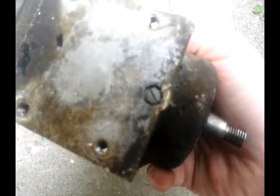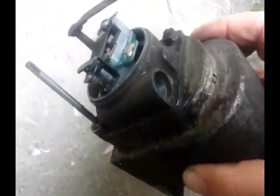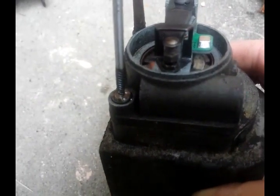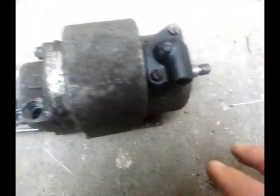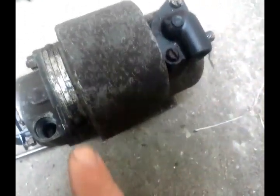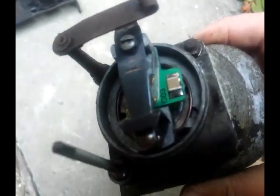Underneath here you'll see there's a little screw — that's a short-to-earth screw, so if you get over-voltage inside on the windings, it's got somewhere to jump to the case and stops damage to the laminations inside. I've started taking this one apart. I've got a tap extractor in there because there was a funny little security-type screw which was almost burred off, so I had to put a little drill in there and run a tap extractor in. You can also tell which direction it rotates — there's an arrow pointing in the direction of rotation.